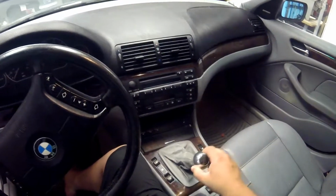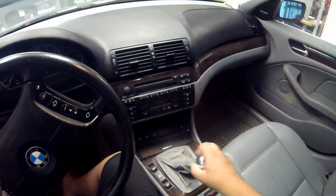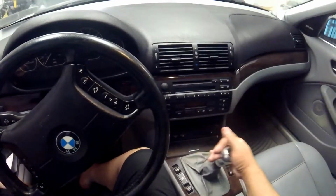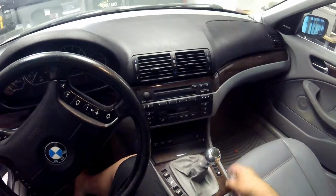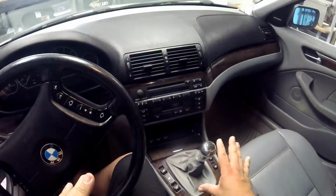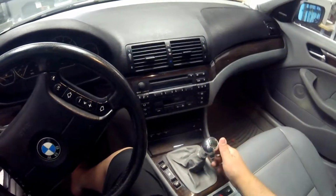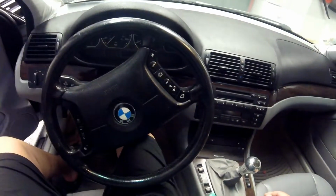Second, same thing. Third, same thing. No matter where I go, it's a lot of play. Fifth, not too bad, but still more than it should be. Of course, reverse is way over here, and still a lot of play. That shouldn't be, so we're going to fix that too, I'll show you that. But mind you, the 330i is different than the 330xi, different shifting components. So we'll get started on that, then I'll let you guys know.